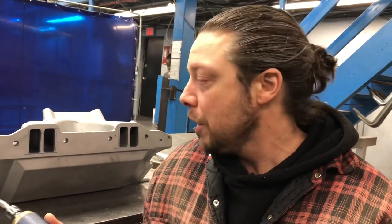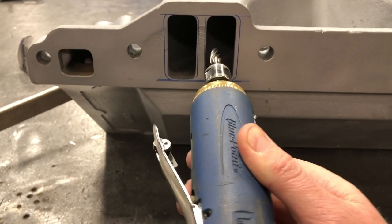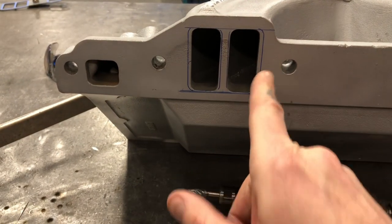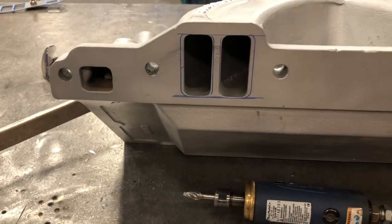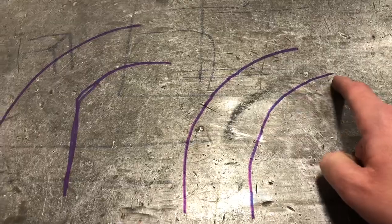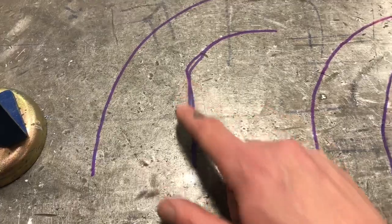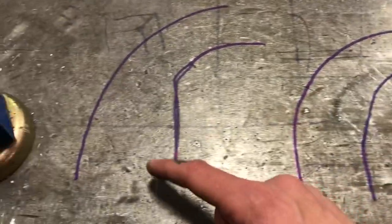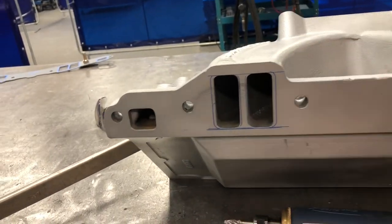I've got my piece secured at the table, all laid out with my carbide burr ready to go. I want to show a little bit of technique, because you don't just want to start hogging out material without a plan. You want to go in nice and straight — don't just put a 45-degree angle to bring it out to the line. Go in about an inch and a half to two inches; the further into the port you can go, the better. With my crude drawing here — this is our current port design with a nice radius. Even though we're going to make it wider, we don't just want to go straight in; we want to go straight in and then work that radius as well to keep the flow shape. Better flow versus more volume but worse flow — it's a combination of both. Nothing left to do but start making some chips.